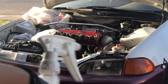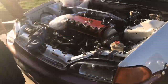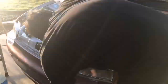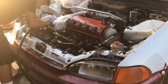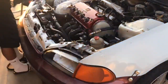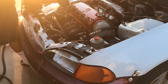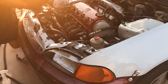Now what you're going to want to do is spray it down with some soap and water and wipe it down. During this process it'd be safe to use a spray bottle — that's what I used — and I also used a hose to hose down some of the bigger parts of the engine. But whenever using the hose, make sure you don't get any water into any sensors, fuel injectors, or anything like that. When cleaning some of the more sensitive or harder-to-reach parts, try using a brush, spray it with some water to free up the dirt, and then clean it up with the microfiber.